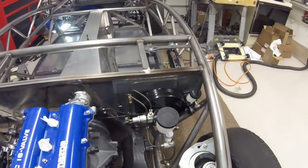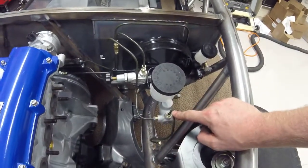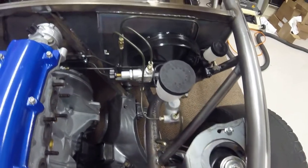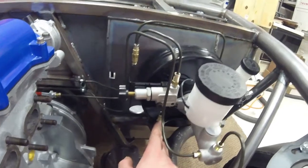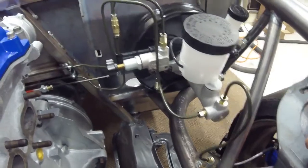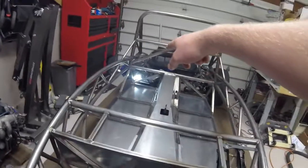Out of the engine bay here you can see my line routing. This one here is for the front driver's side brake line. This one goes along the frame wall there back to here, and this is for the passenger side brake line. And here's my Wilwood proportioning valve — my lower line here is disconnected because I snapped the adapter and I have to order another one from Fly Miata. This rear line goes here and then all the way back underneath the tunnel and to the rear of the car.